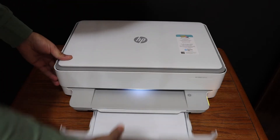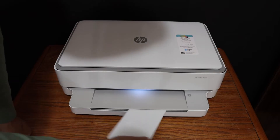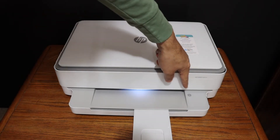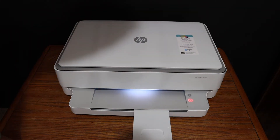The first step is to switch on the printer and load A4 size sheets at the bottom paper tray, then open the paper output tray. Now go to the display panel — you can see the info button here, which is just the letter 'i'. Click it once and it will send a command for the printer to print the printer information page.